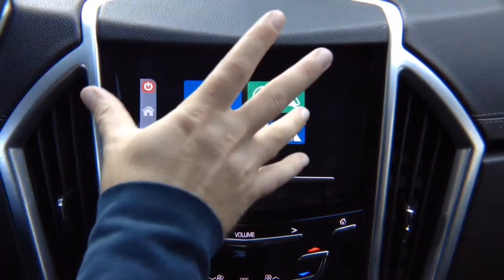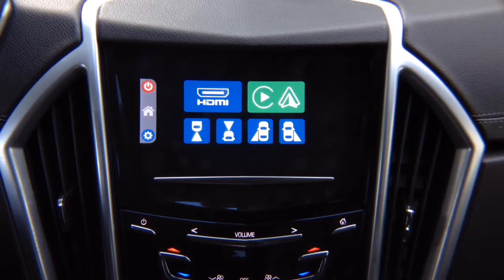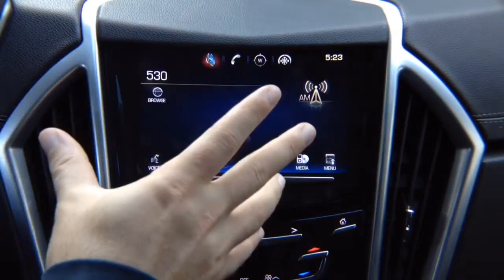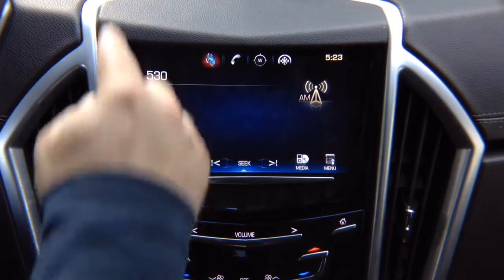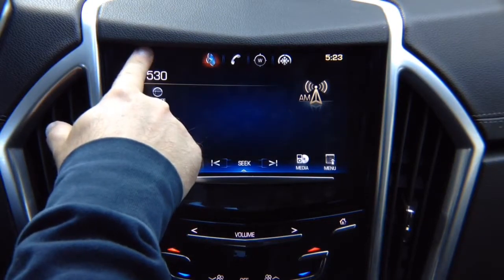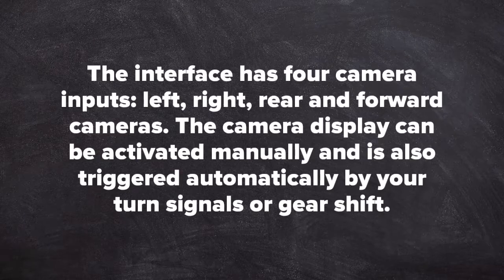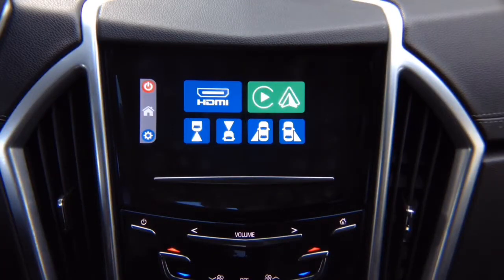When you press and hold the top left corner for a few seconds, it enters the interface and the touchscreen takes over. Nothing in the background is touched — all factory features still work. Keep in mind, this is just a screen — same as a screen in your home, with a touch screen. Everything you see is an image coming from elsewhere in the car. This interface has four camera inputs: left, right, rear, and forward. The camera display can be activated manually and is also triggered automatically by turn signals or gear shift.